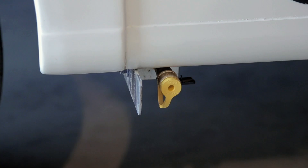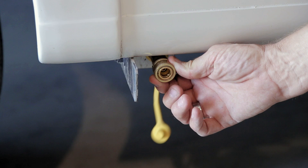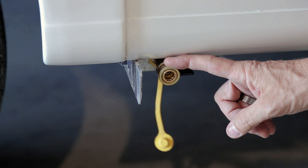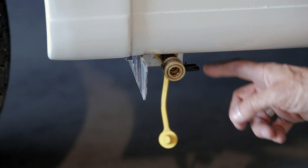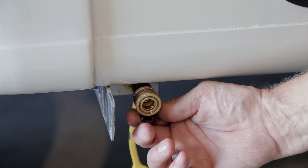Just ahead of the passenger rear wheel, you will find your barbecue quick connect, intended for RV barbecues. This is a regulated line — if you have a barbecue or cooktop with a regulator already mounted, it will not work off this quick connect. Please see your RV dealer for compatible items. There is an on/off for the propane flow just to the right-hand side of the opening — flip it forward to open, flip it backwards to close. Always ensure this valve is in the off position when not in use.